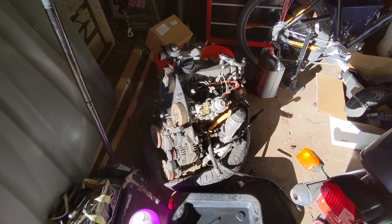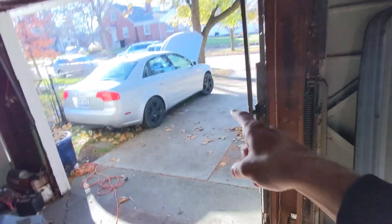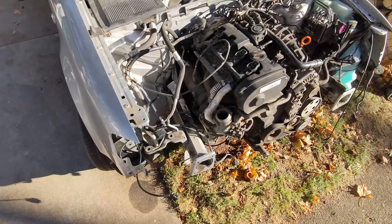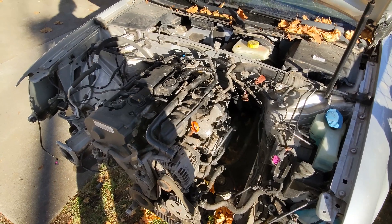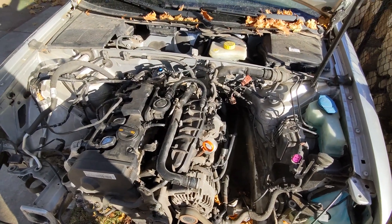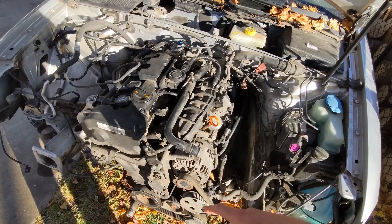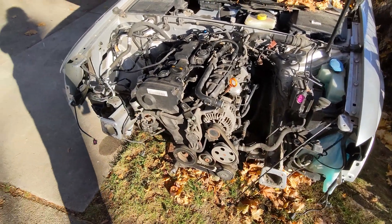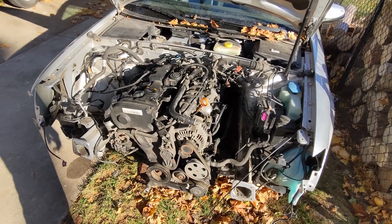And then I'm going to pull that other engine today. Hopefully I'll probably do that timing tomorrow or maybe later today, depending on how I feel. But the big thing is to just get this motor out while it's still somewhat decent outside. Basically just loosen up the motor mounts, unbolt the exhaust, unbolt the bell housing, and then this thing should just slip right out. Also thinking I might pull the power steering pump — might be easier to just bolt this one up to the other motor than hook these lines up to that other pump. Let's get cracking.